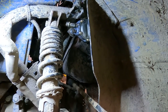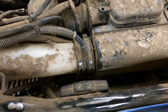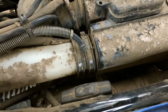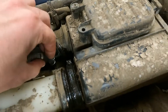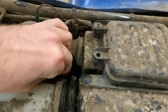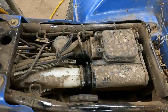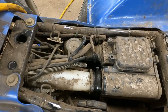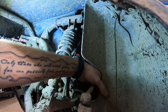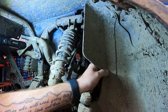I have the fuel line unhooked still and I'm going to try to start it. That worked out pretty good — there was still gas in the carburetor from running it on the umbilical tank, so it fired up and that helped prime the fuel pump. Now the fuel pump is primed, I'm putting the fuel line back on it. Now it's running on its own power. Alright guys, I hope this helped — until next time, peace.